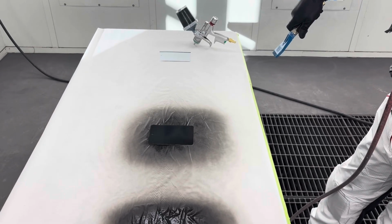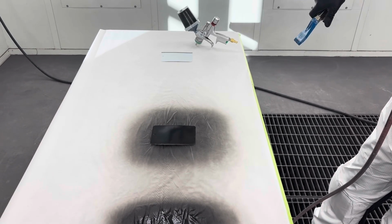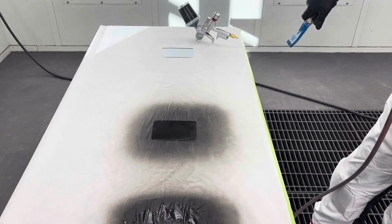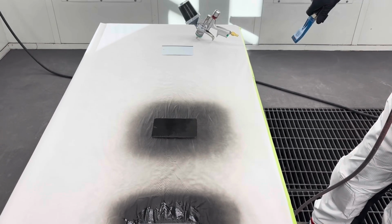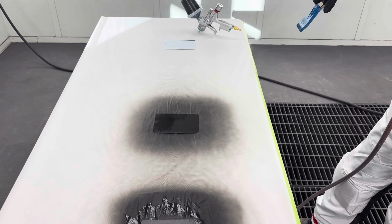That particular tool, which is a blade style venturi or dryer, can be used correctly by increasing the distance. And also consider when using these tools that you do have a regulator on it to control the amount of compressed air that comes out. You may not necessarily need the venturi turned up to its full capacity. Partial capacity is usually sufficient when drying paint. And of course, the closer you are, the lower the air pressure that's required when using the tool.